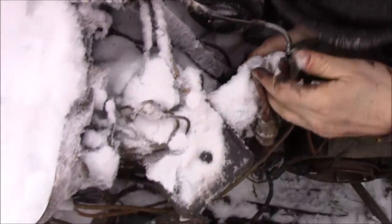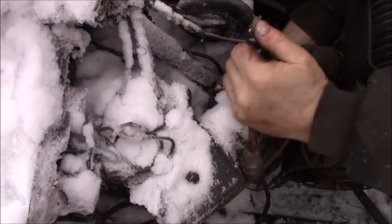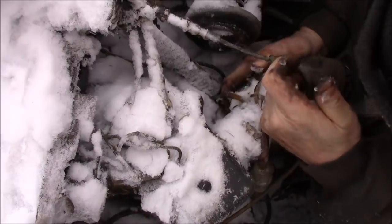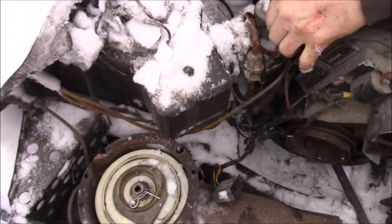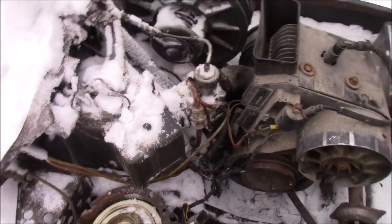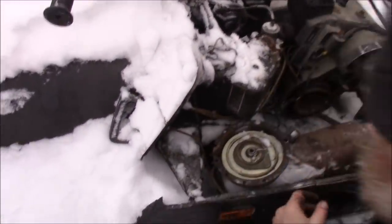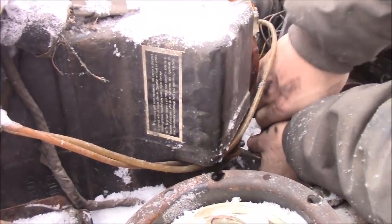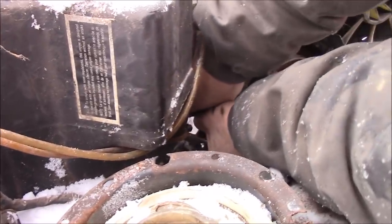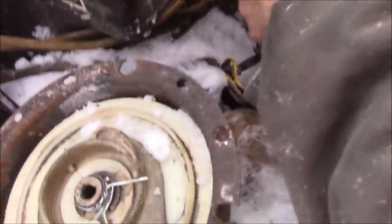Carburetor in there, line up the tab. There we go, that's lined up. It's in there, got to straighten that up like that. Tighten that down. Gonna hook up the fuel pump line. Fuel pump line's always easier to do when the engine's out, but we're just gonna push that on there anyways right now. Fuel line's on. I just gotta do up the clamp in a minute here. Everything's still all good on there.